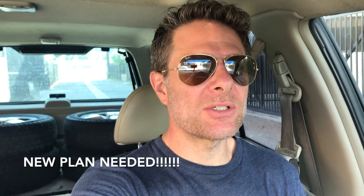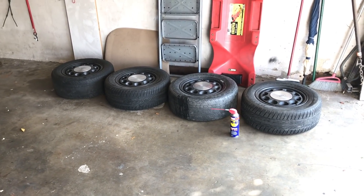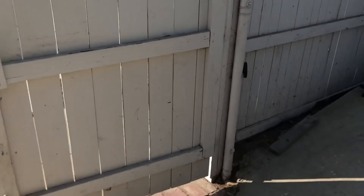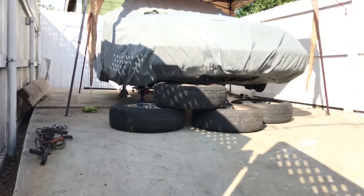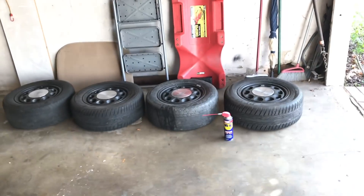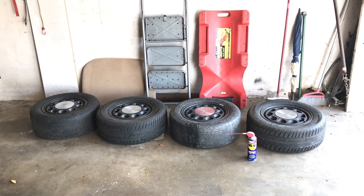The plan has always been to go bigger with the tires and wheels on this car, but I thought I'd put the originals on for now. If it's going to be a pain finding stuff to fit, after much pondering — and if you follow me on Instagram at Nathan's Garage Official you'd have known — I ended up going with Mustang 10-holes. One thing I really hate about the XR is the wheels are a higher offset, pushed into the arches, and 16-inch ponies rub on the fender wells really badly at the front.